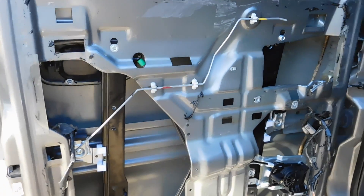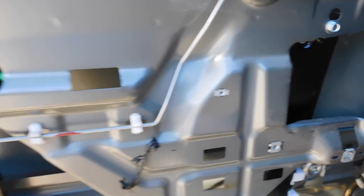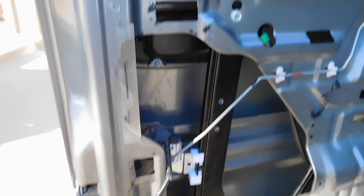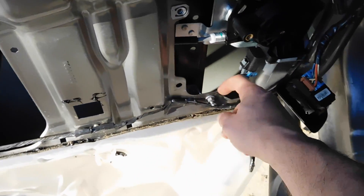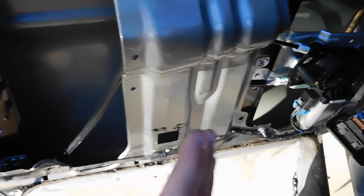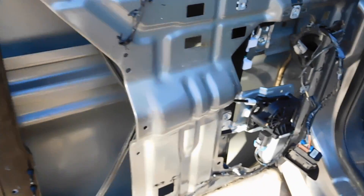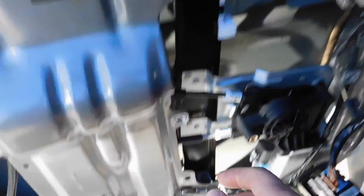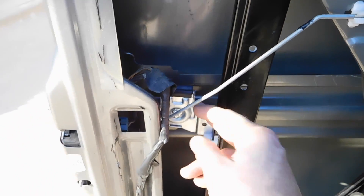I got the regulator in — it takes a little bit of fiddling. I had to go back and review my notes of how this came out. Basically you've got the keyholes up here and the mounting studs that come out right here. You make sure it folds up so you can slide it into this area. The motor has one little bolt down here and then four that hold it in. I think we're ready for the window next.